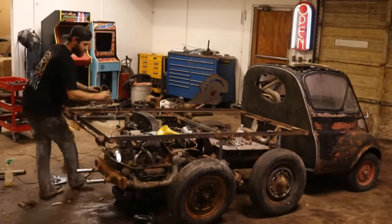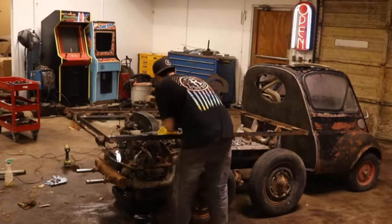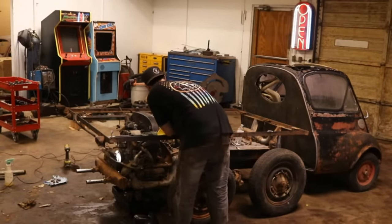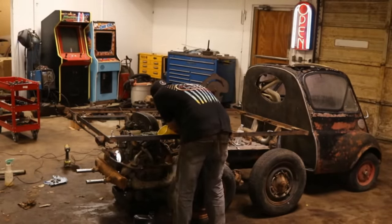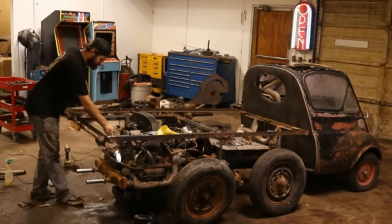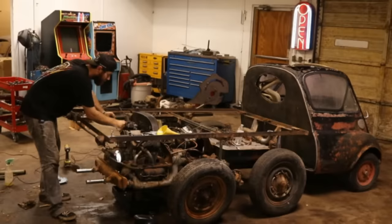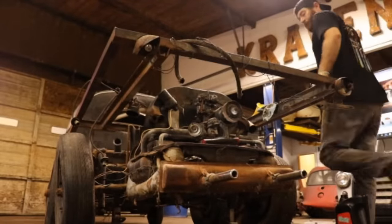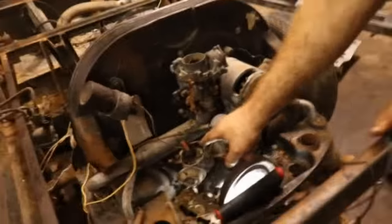All right. So I'm going to see if this will try to spark when I touch it here. Nothing. I may have to wait until he gets, or Christian, I could probably have you check. So I'm going to put this wire here, and I need you to look right here inside this thing and see if it's sparking. You're going to be looking in this area right here. These are the points. They'll be open and closing. We're looking for a spark in between there.